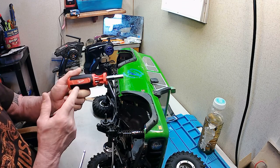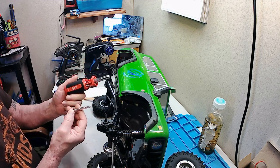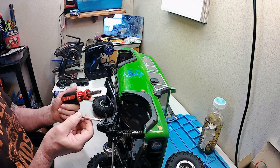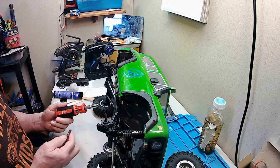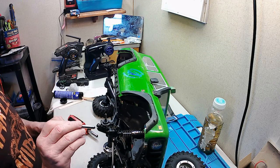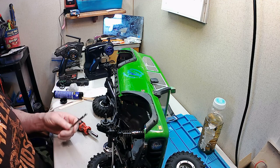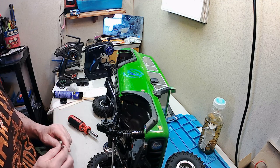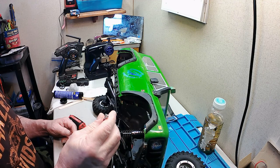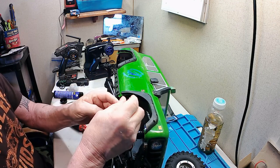This is the Milwaukee tool I'm using — I found it at Home Depot and I really like it. It'll chuck up in a drill or in this handle. For this job you don't want to over-torque these screws, so I'm not even using the handle to torque them down. They're small and you're threading into plastic — if you over-tighten them you'll rip all the plastic out and then you have to use super glue. Also on a plastic-to-metal screw I do not use blue Loctite.